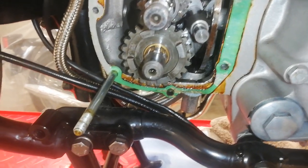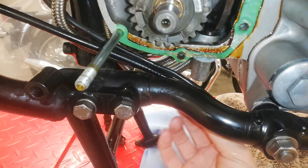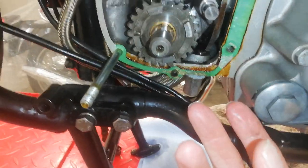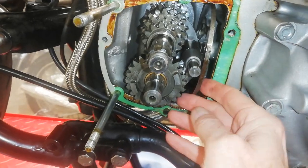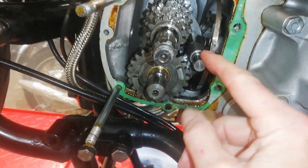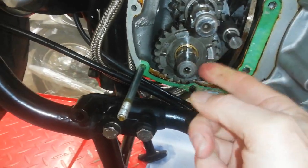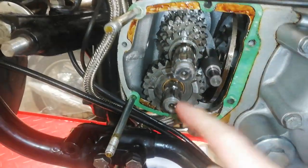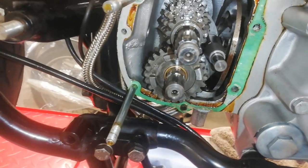The plunger sits on the edge of this cam wheel and that provides a solid gear change, but it's also pretty tight. I'm going to remove it completely to take the plunger off, and that will free up all the tension in the gearbox. It'll then enable me to remove the gear fork selector shaft and take off the rest of the gears.